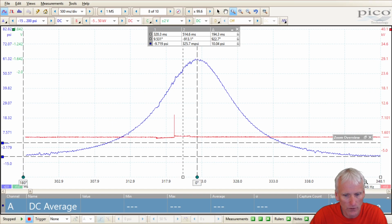So the delay that we're looking at is between when it's reported on the scope and when it probably should have happened. If you look, that's 1.25 milliseconds, or roughly a millisecond. So there's probably a millisecond of delay between when it actually sees the pressure and when it reports it out to the scope. That's actually not too bad. When we saw those specs and they said response time 1 millisecond or less, I'm sure that's what it was referring to, not the frequency of the voltage output that it's delivering.